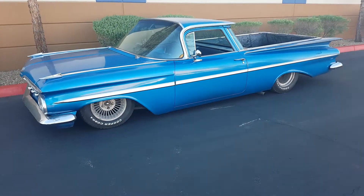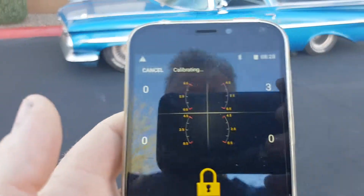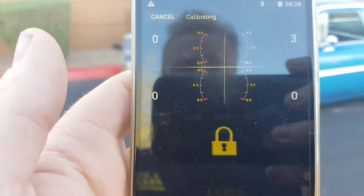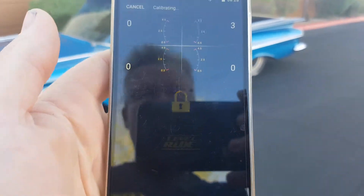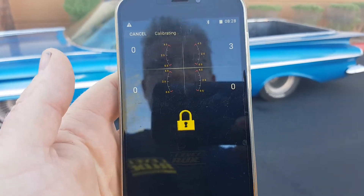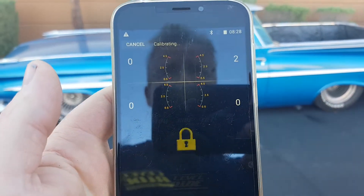We then press start and the vehicle will start dropping. If the vehicle doesn't start dropping, you could have set your pressure too high or you could have another issue, and you can just do a start again. Once it comes down, not all of the gauges will read absolute zero but they'll come pretty close — anything under 5 psi is considered to be aired out.